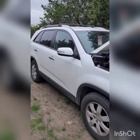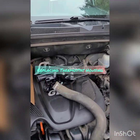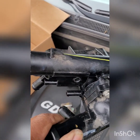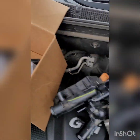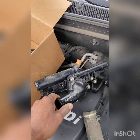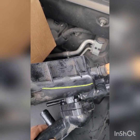What's up guys, today I'm working on a 2014 Kia Sorento replacing the thermostat housing. That's a common problem on these right here. This is a common problem from 2010 all the way up to now - I've replaced several of these, even on Hyundais. They crack right here - I highlighted the crack so you guys can see it.